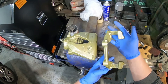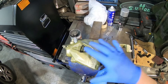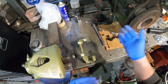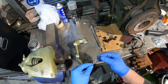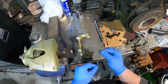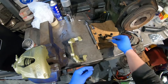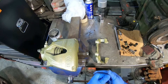Here we have the finished articles. It's taken a few days — I've been leaving it to dry in between coats. I've done two thin coats of gold and one thick coat to finish off, and I'm really pleased with the results. I think these are going to look really nice on the car. I've polished up the clip with a bit of Scotch-Brite and some wire brush on the drill first because some of it was pretty bad, and I've also used cutting compound on that. I've cleaned up the slider pins on Scotch-Brite — they'll also have some grease on them when I reassemble. All I've got left to do is put the rubbers on, and then I've got new discs and pads to go on the car.